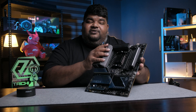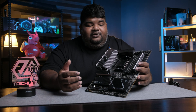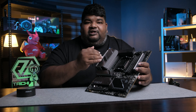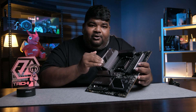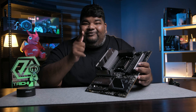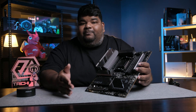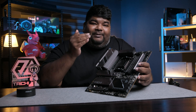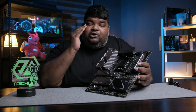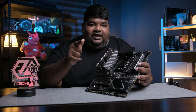What's nice about this motherboard is that, in line with new power requirements of processors, most motherboard manufacturers have amped up their VRM configurations. In this motherboard, you've got a 27 power phase configuration of 24+2+1. The best part is that it comes with 110 amps of smart power stages, so if you're into enthusiast overclocking, it has you covered.